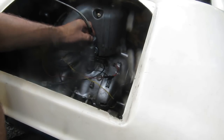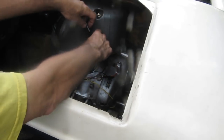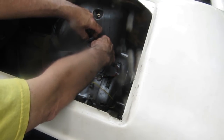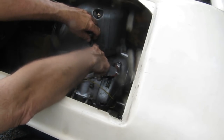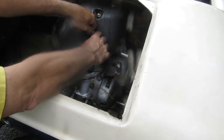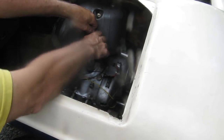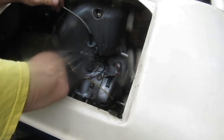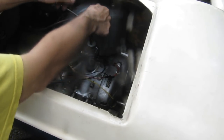Okay, so now it's sliding in. Sometimes you have to use your finger to guide the main needle in. This top disc has a gasket underneath it, which we can't see probably, and there's a tab that it keys into. And that's in place. This top ring just goes on hand tight. Just going to turn the fuel on there, undo the clip. Spark plug wire back on.